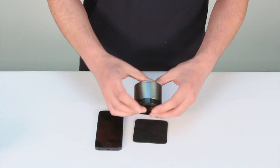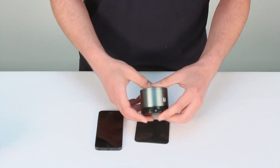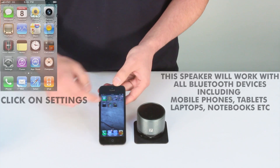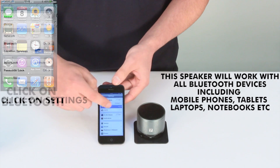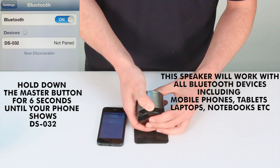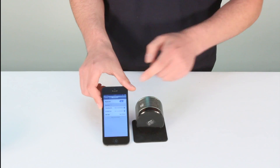To connect the speaker via Bluetooth, you must first turn on the speaker via the switch on the side of the device, then go into your mobile phone settings, click on your Bluetooth tab and on the speaker hold down the master button for 6 seconds until the blue and red light flash, which makes the speaker discoverable on your device under the name DS032.